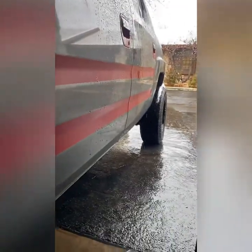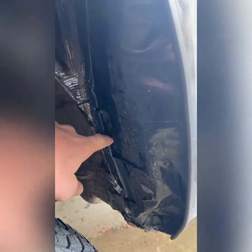Looking at these tires that I got yesterday, I'm going to go back and recut or retrim some of the pinch welds. I was looking at a buddy on Facebook with the Off-Road Ridgeline Facebook page or something like that — he has 35s on his, which is dope. I was looking at his cuts and his wheel wells; they're a little different than mine, a little more clean. So I looked at how he did that and I'm going to replicate it. He had his cut straight over, then straight down, then cut out the bottom. I'm going to cut this out and show you after I'm done.